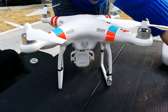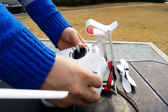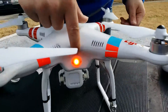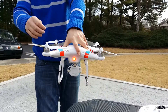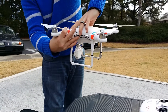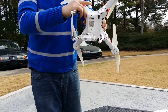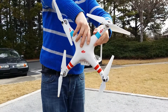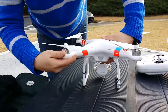Now what we want to do is the GPS attitude and manual switch — the S1 switch — flip up and down five times. That turns it yellow. Now don't spin it around your body; you spin the Phantom 360 degrees until the light turns green again. Then nose down, clockwise, another 360 degrees. This is calibrating the compass. After I do this I will put it down and it will actually flash green, showing that the flight controller is ready.